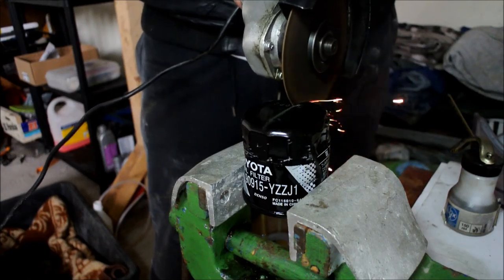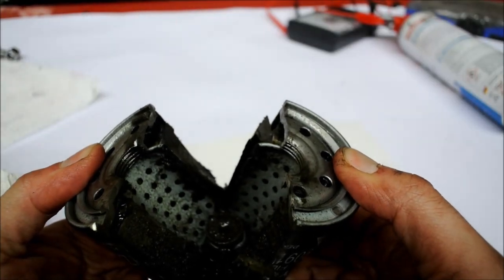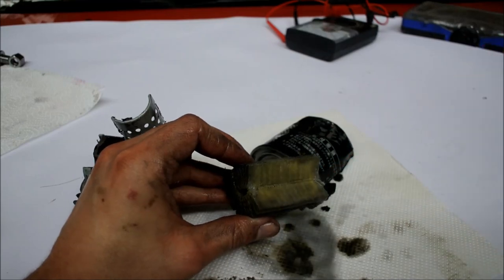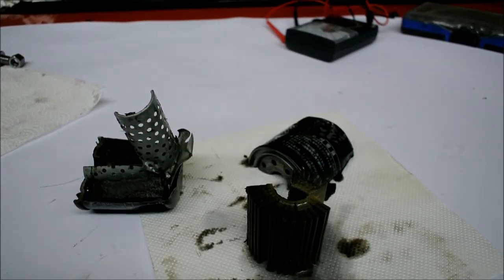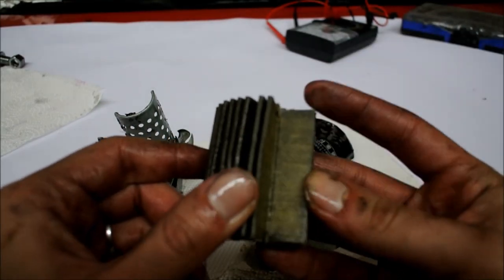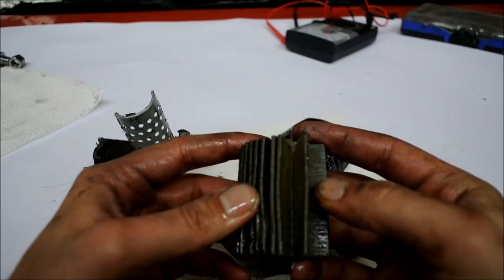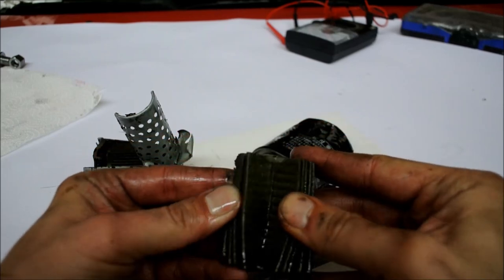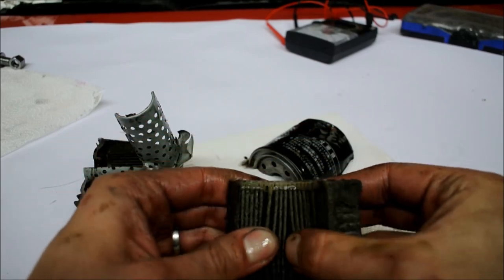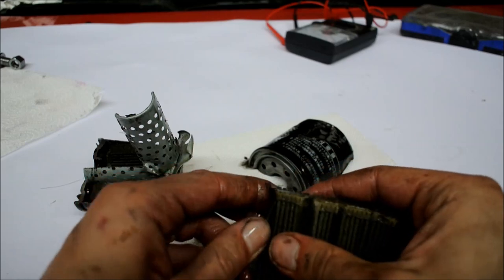Another great way of seeing how your freshly rebuilt engine is doing is to take a look at the interior of your oil filter. First drain all the excess oil from your oil filter and cut it open — you can do this easily with an angle grinder. Then split apart the oil filter and take a nice look between the pleats. You are looking for any hard particles visible to the naked eye. As long as the pleats are clean and there is nothing big and hard, your engine is doing well.